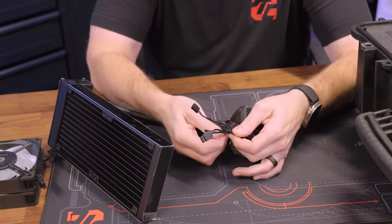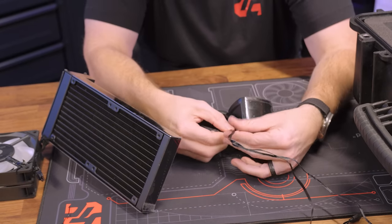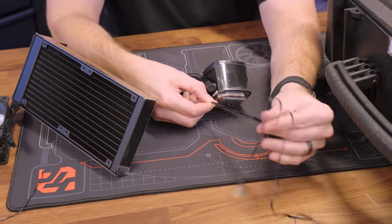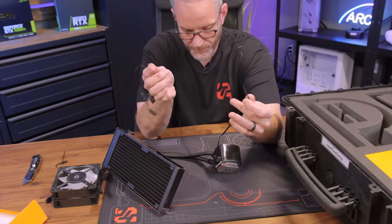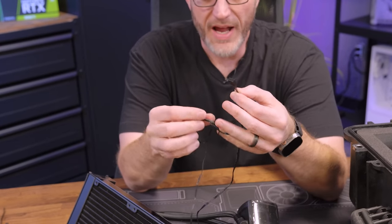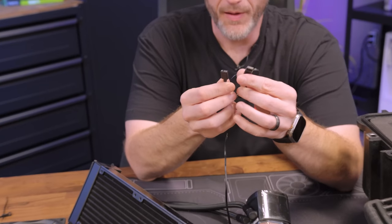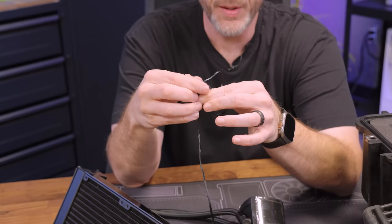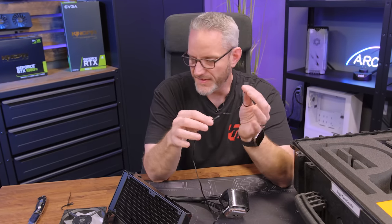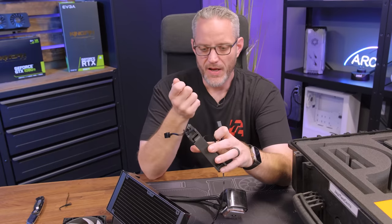You could easily route the wires up and around your VRMs and around your memory and make them hide nicely. Because they're fairly flat, you could train these to go a little straight since right now they've been bundled up. You could sort of zip tie some of those together and easily hide those wires. We just have two leads here. All it's using is a fan header — you hook this up to your AIO header or your high-amp CPU header on your motherboard to control the pump. And then this is just an ARGB 3-pin with a pigtail so you can split it off to other devices, using up one header on your motherboard.